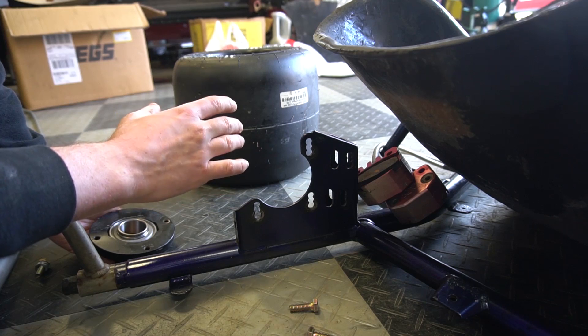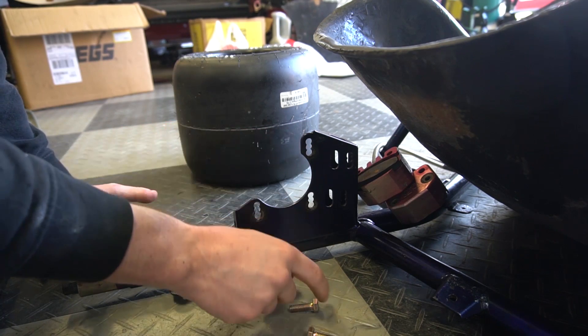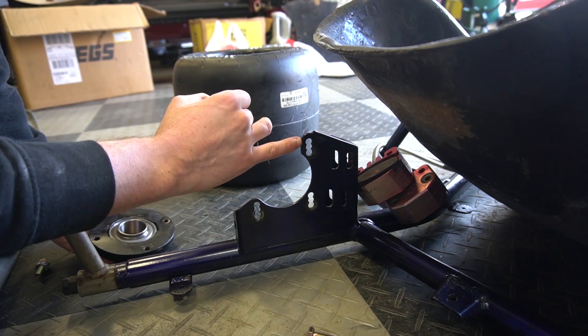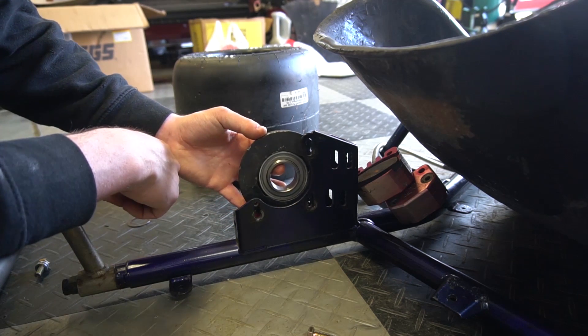One of the reasons I like this chassis is because it's very adjustable. The ride height on the rear axle is adjustable — it has slotted holes for the bolts to go in. The higher you mount the bolts, the lower the go-kart's going to be. This is probably going to end up in the grass at some point, so I'm going to mount it on its highest setting.